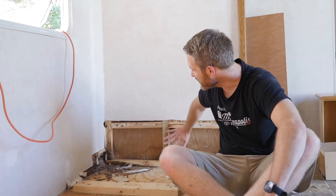Right behind me is one of our water damage areas in the RV. We ripped up the couch and the dinette and the carpet underneath them. The previous owner had actually repaired some of the water damage — they pulled out this panel, replaced it with another panel, and the floor as well. But they didn't seal it up properly, so it's starting to leak again. This is a little bit damp since it did rain the other day, but the board itself isn't rotted through. As long as we seal it up on the outside we should be fine, but we are going to have to tear this out and replace the bottom panel to make sure we don't have any mold inside the walls.